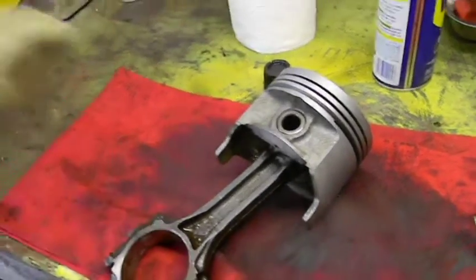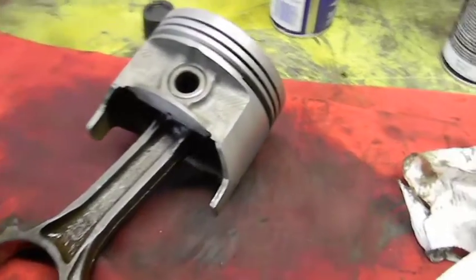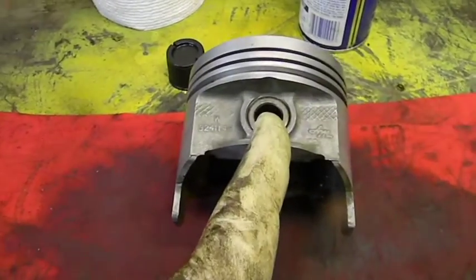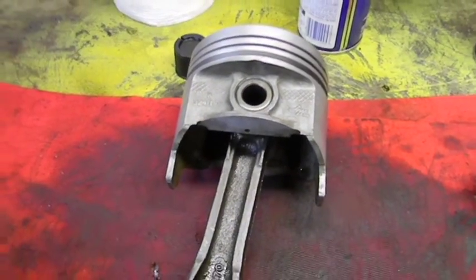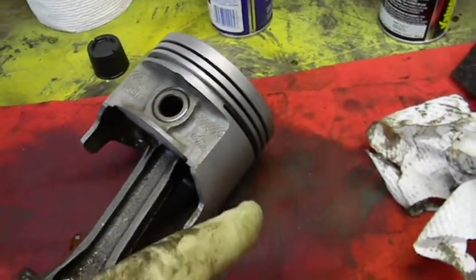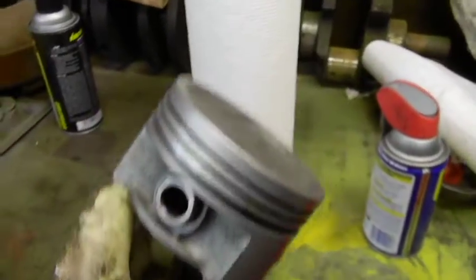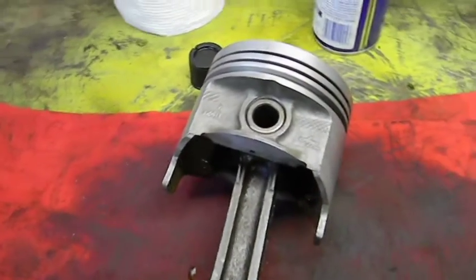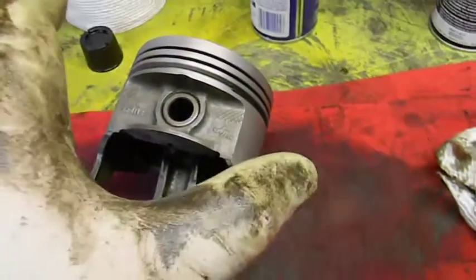I figure maybe in every video I'll put just a little bit of knowledge, like I used in the olden days. Okay guys, this is for the novices — I know you experienced guys know all this. This piston pin is not in the center of the piston; it's offset to one side. As the piston goes up, the load against that one skirt is called the minor thrust angle. When the explosion happens and it comes down, the load on that side is called the major thrust angle.